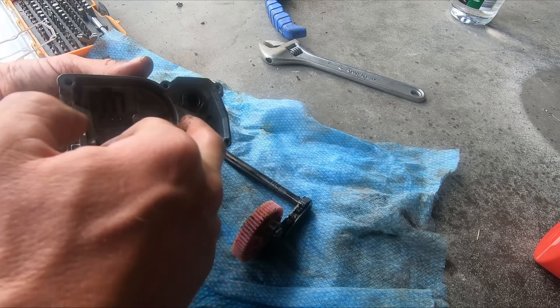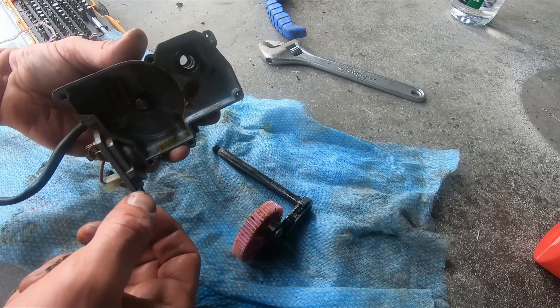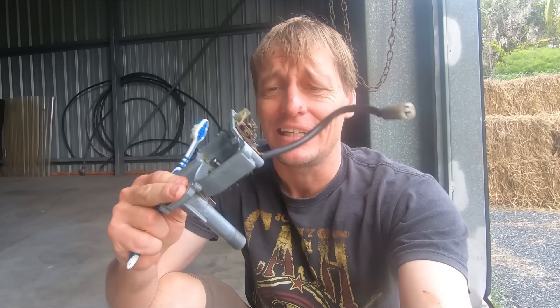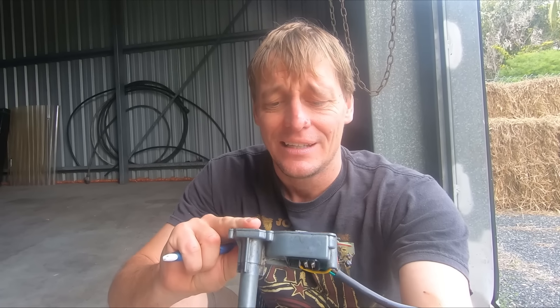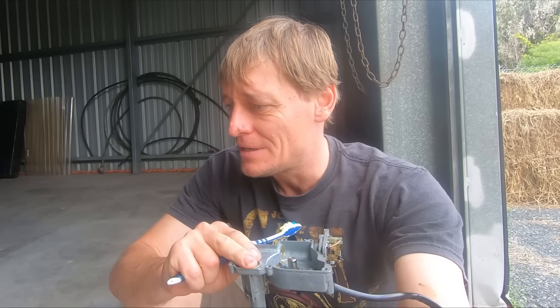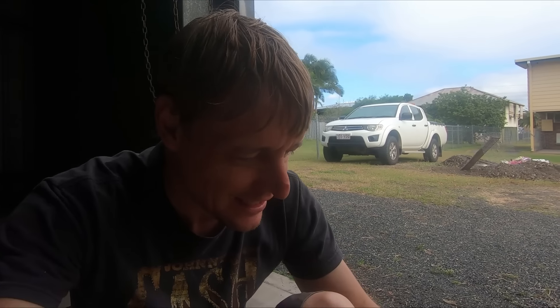All this grease is getting pretty old and hard — not the best. So I'll give it a good degreasing, clean it up and re-grease to see if I can get a few more years out of it. In my spare parts kit I always say carry an old toothbrush — really handy for cleaning things like this, getting into all the little nooks and crannies. I don't want to use water on this, so I'll use the degreaser, then some methylated spirits and inox. I don't need any other grease other than this automotive bearing grease.